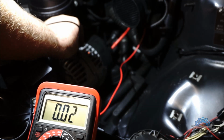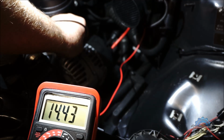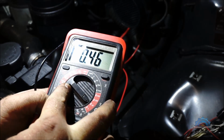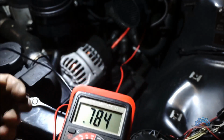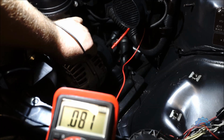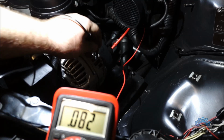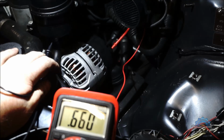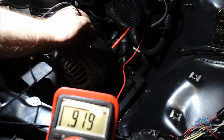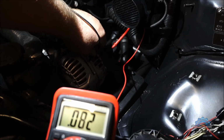This is a slightly bigger alternator, but it looks like it's giving better readings. So now the last test, again AC current through the system with the load on. Set AC millivolts. It's 82. I'm not sure if that 50 millivolt range is spot on, because there are many people saying that 100 millivolts is the deadline, but we can see a big difference between them.